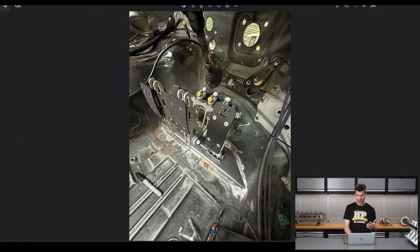We've got the pedal box already fitted up in the car — this is just a picture taken while it was being dummy set up. Brandon has been making use of our Peel 3D scanner in Fusion 360. He used the scanner to scan the floor pan in the area where the pedal box is going in, because we need a strong base so there's no mechanical compliance when the brake pedal is pressed hard. He then designed and folded up a little plate — tacked in at the time of the photo but now fully welded. That was really quick and easy based on the scan, whereas the complex shape of the floor pan would have taken a lot of time to fettle without it. Our 3D scanner is continuing to pay for itself.